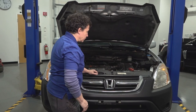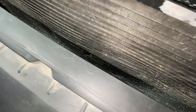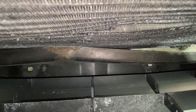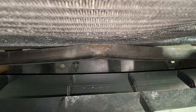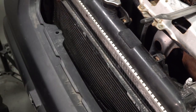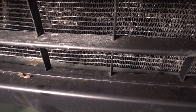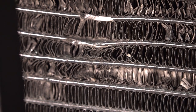I've got this all ready to come apart to give you a quick visual of what's going on. This comes off, and that comes off, and there's our AC condenser exposed. Here's the AC condenser, and here's the bumper that got replaced. This pushes in, and down below here we have a bumper support. You can see right where the impact was, right here — it glides and smashes right into that AC condenser, which is aluminum. I showed you how delicate and easy it is to bend. Look at this thing — it's like an ocean wave. This car, the Freon doesn't work anymore. It probably worked several days after the fender bender, or maybe it happened in the wintertime and this customer never turned the AC on until two or three months later when they wanted it. Didn't work.